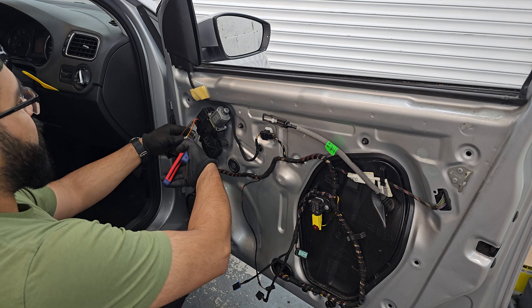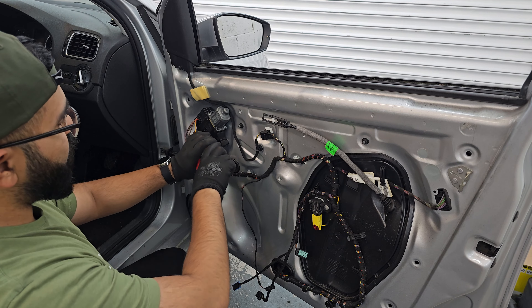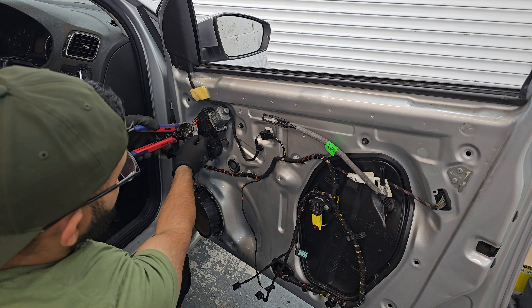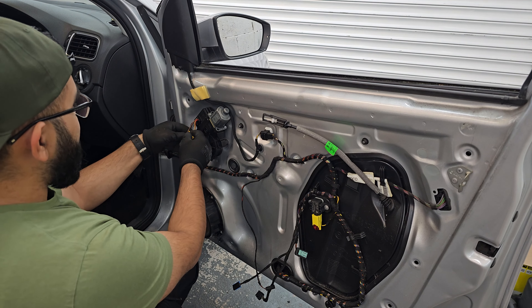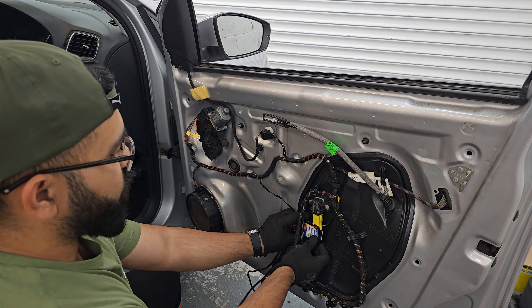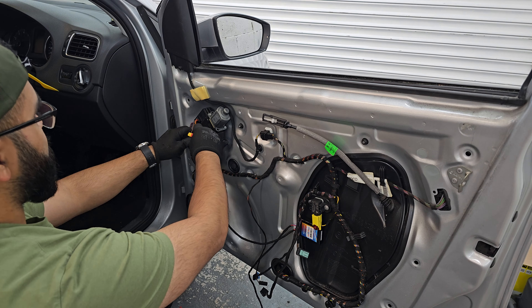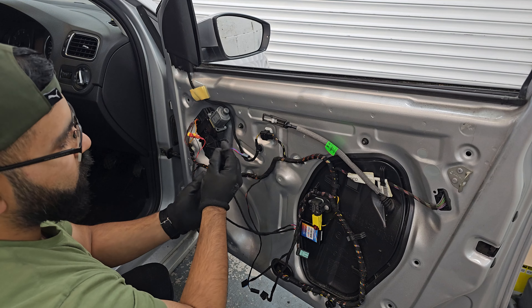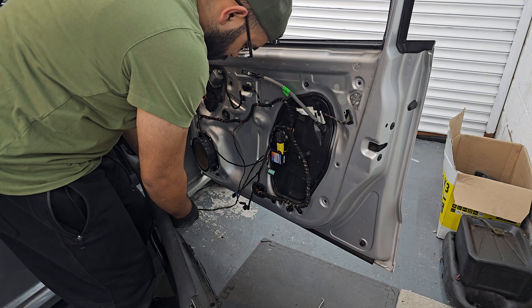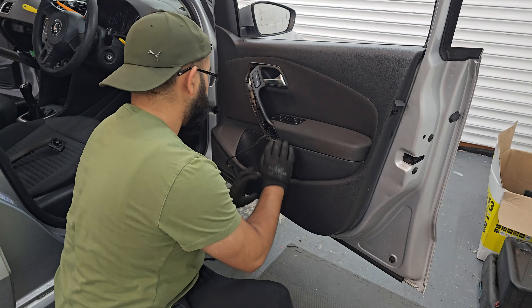It's the same on the front and rear: we need to get access to the thick red and yellow on the front, and brown which is the earth. So the red and yellow — or yellow and black on the rear — is the live, and the brown is the earth. It is a constant live, so just be careful of that when working here. With these little T connectors we can just connect it up like so. Now we can get the actual module — I'm going to put it just over in this corner here. The live gets connected up just next to it, and now we connect this wire to the LED strip on the door — like so. That's perfect.